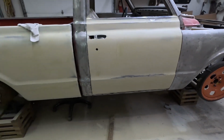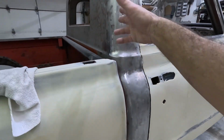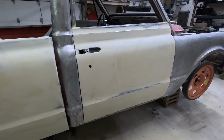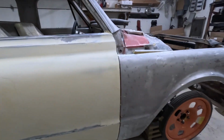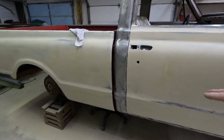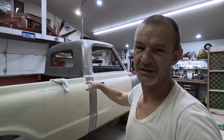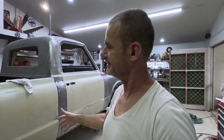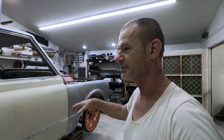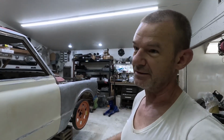And the passenger side will be basically done. We'll get in here and do this door column. I haven't sanded the back, that's why I haven't done any of it, but we'll get on that. I put the car up very high. It's easier to sand. The higher you can get the car towards eye level, the easier it all is to sand. If you keep it low, you're always bending over. It makes you sore fast. You get the car up as high as possible, right at eye level pretty much, or a little lower, it does make it a lot easier to sand.